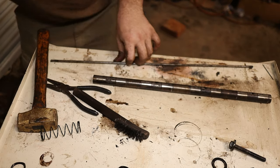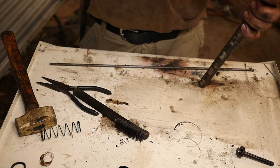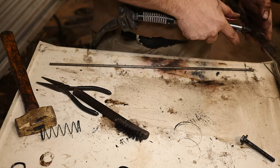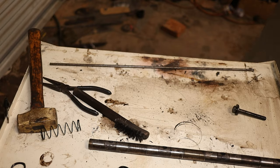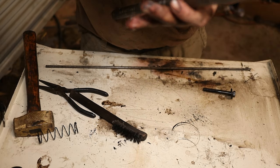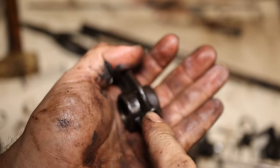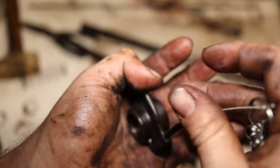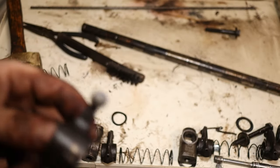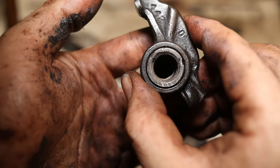Alright, so we're back. I've cleaned up all the rocker arms now and the pedestal, and I'm going to go ahead and blow these out. Next thing you're going to want to do is take your rocker arm and check all the holes. You've got one coming through the back that goes all the way into the bore of your rocker shaft, and one that goes down through the push rod to hold the tip of the push rod. You want to check the inside of your bore and check the wear on the tip, and make sure that there is no play on your shaft when assembled. This one moves just a little bit and I'm going to say that that's fine.